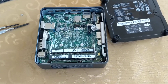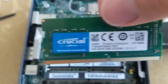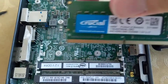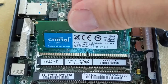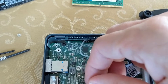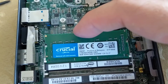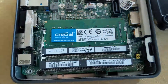To put it back together, just do the opposite. Take one memory module — notice there's a notch in it, so it only goes in one way. Usually the label will be on the front. Put it so the metal on the bottom goes into the slot, and once it's in, give it a very gentle push down and it clicks and holds in place.